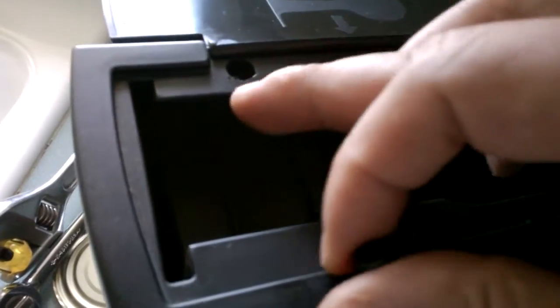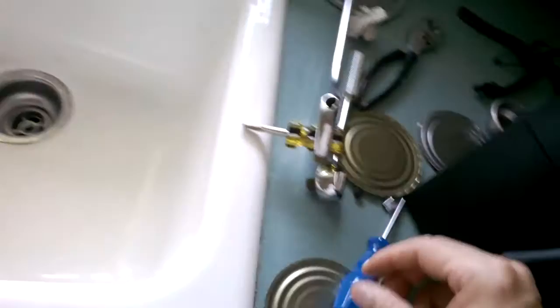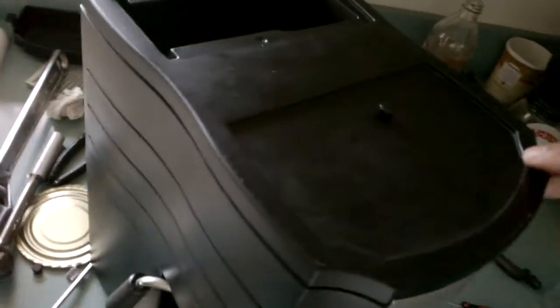From what I've seen in Vladimir's video, there are actually two screws here. Instead of trying to pry this open, I'm going to use a sharp instrument to pry out this little plastic cover right there. Under it there are two very small Phillips screws. I'm going to take those out and should be able to slowly pull this top piece apart.